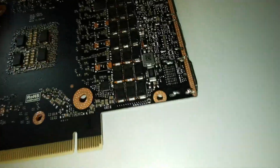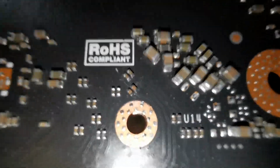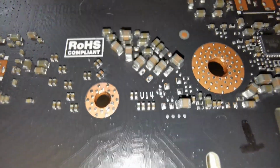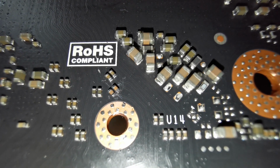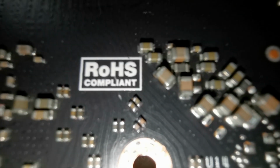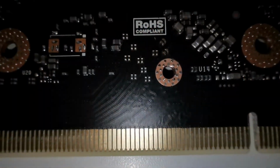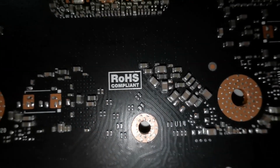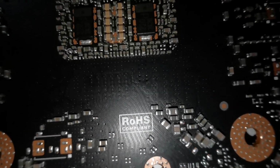So the master has performed the repair, and you can see 2 new elements which differ in color at the place where they were torn apart. You can see a small line in between the 2 elements. This was from my attempts to fix those. And you can see 2 scratches, one below the logo and one inside the logo. Those scratches, as I was explained, were made to test the circuit integrity at the place of the soldered elements. And those lines are going inside the PCB and supposedly into the video chip itself.